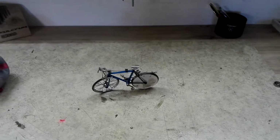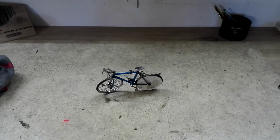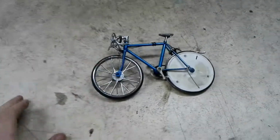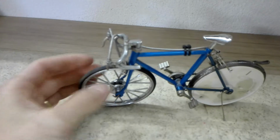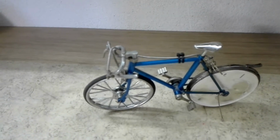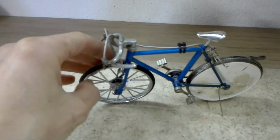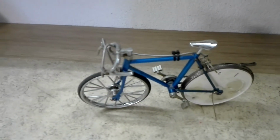There are a lot of manufacturer charts which are producing tires, but the problem in there is that they're measuring the rolling resistance practically only on the front wheel. They have a special holder, and then they're increasing the pressure on one wheel, and they're measuring the watts, how much power is necessary to run the tire on the roller.